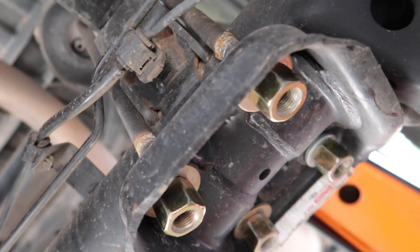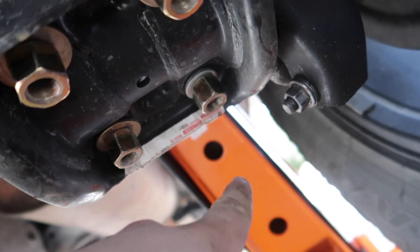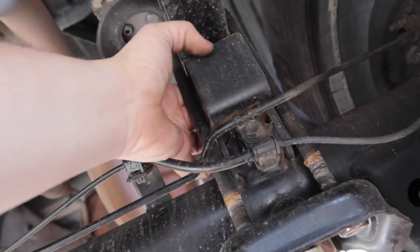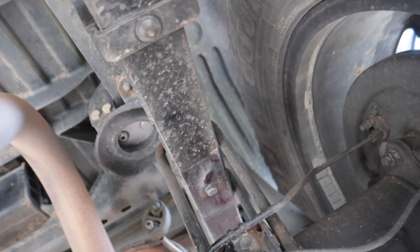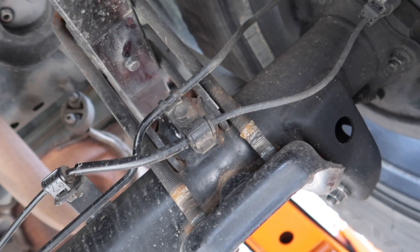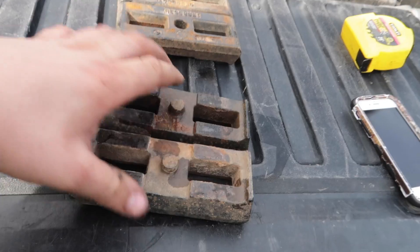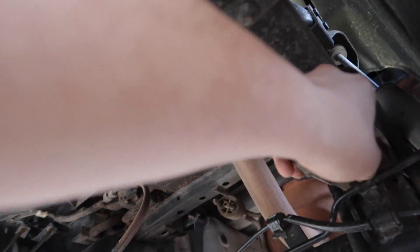What all you have to do if you're just taking blocks and lowering it — a lot of people like to squat their truck, but I'm just making it sit level — is loosen these bolts just a little bit, and you can lift that up with a jack. You can see right there I have the leaf lifted up by the jack. Now I can lift up this block and move it right out of my way. The two inch block is gone, and now I get to put a one inch block back in. This is not hard work, you just got to take the time to do it. If I wasn't filming, it would take about 15 minutes altogether. These are the Chevy Z71 lift blocks off a stock Z71 truck that got lifted.